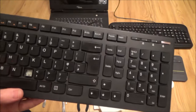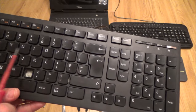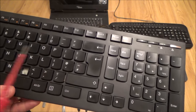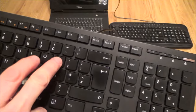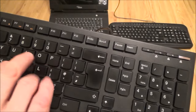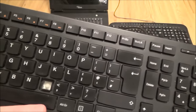If you do all that and it's still not working, you'll have to pop the key off to clean underneath. If after cleaning it's still not working, there's not much else you can do — the price of keyboards means you're probably better off buying a new one. It could just be worn out underneath, but this video will help if you've spilt something on it or it's just dirty and grimy.